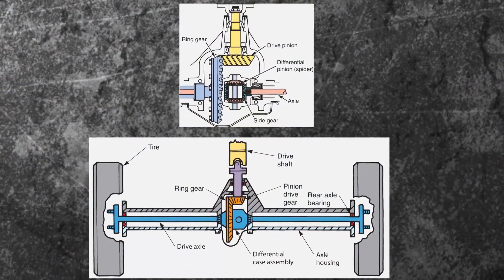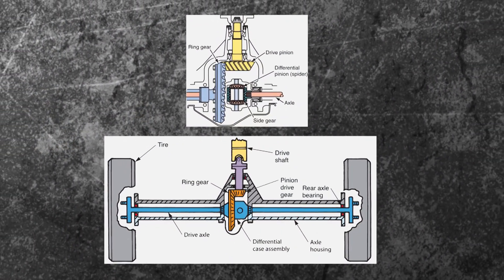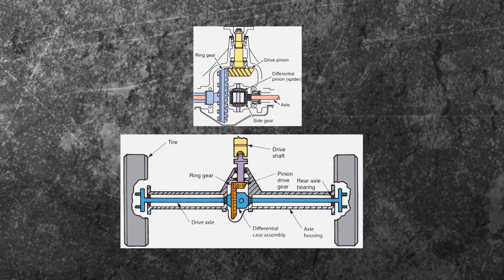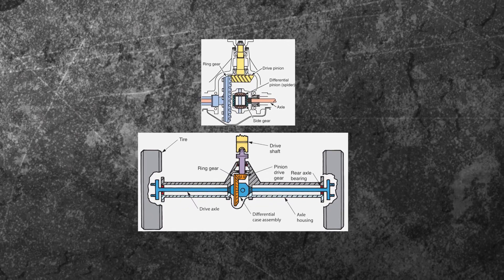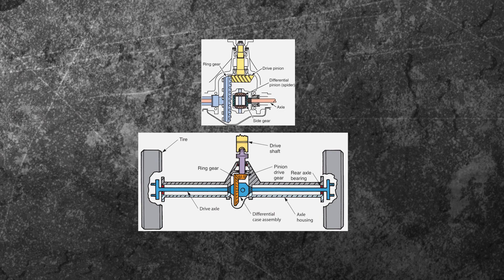What's going on inside of there? Well, you can see it right here. The pinion's coming in from the drive shaft, driving on the ring gear, and we're getting our power out there. But there's a lot of torque and action going on between those two gears.